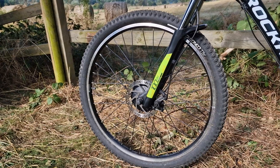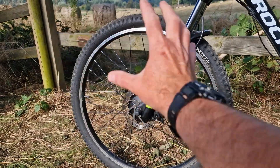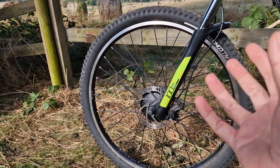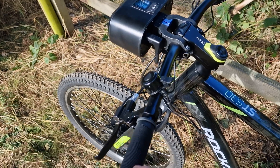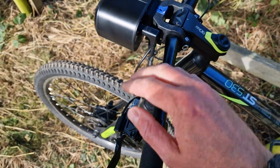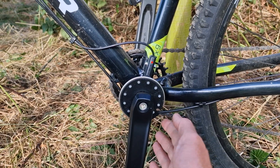Also in the kit you get this complete motor wheel which includes a 250-watt motor hub. The whole rim comes as one - all you've got to do is take off the tire of your old wheel and put it on this new one. This is an Alex Rims wheel so it's super strong. Other parts in the kit include brake sensors so you can adapt normal brakes - that's just a safety measure so it cuts the motor power when you apply the brakes.